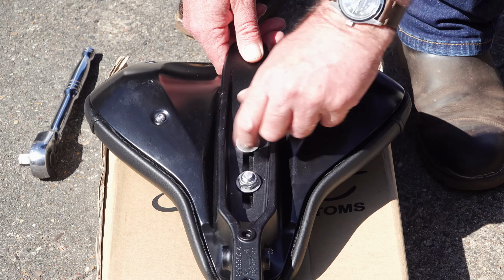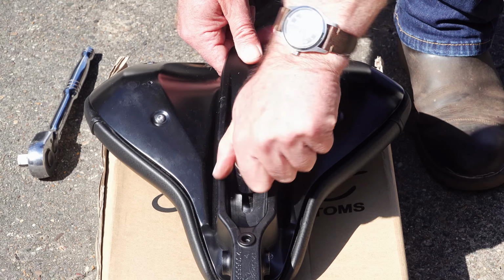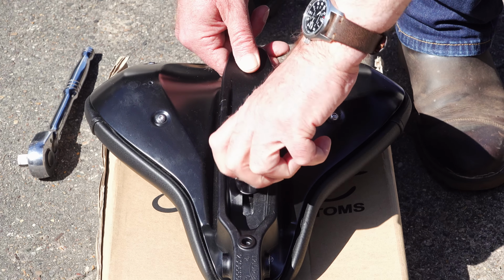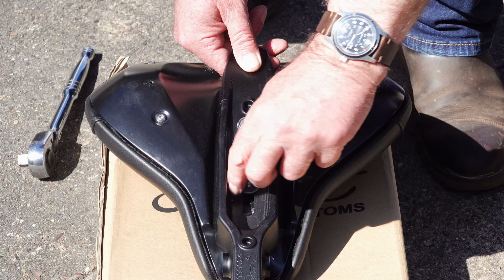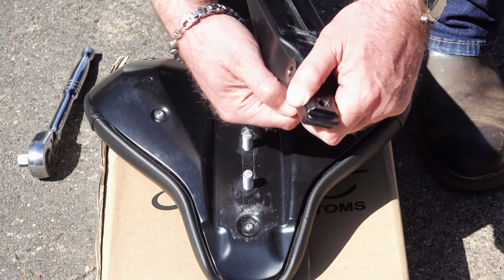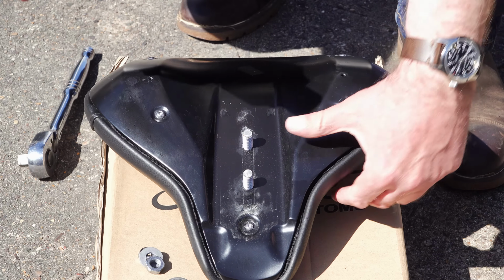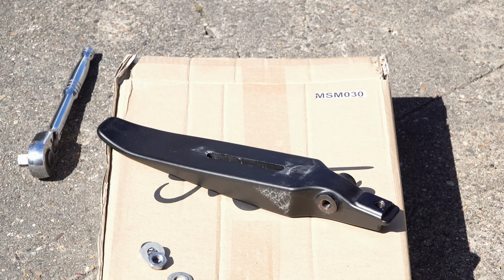Now, the development of these seats has been going on for some 2 or 3 years. I know Sam at Motone tested various thicknesses of steel seat pans, and from what I remember, it opened up a whole can of worms. Now, what it boils down to is 2 or 3 things. Safety is an issue because it's a seat. Got to do its job and it's got to do it properly. Stock grades of sheet steel vary enormously from one thickness to another, with 2.5mm steel being the most freely available and the cheapest. And on paper, it should be strong enough, but when Motone tested it, they found it was too flexible. And occasionally, on rough roads, it was flexing enough to scuff the rear fender on the Bobber.